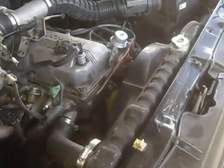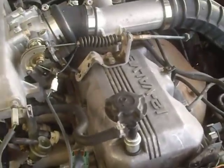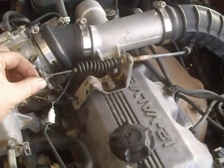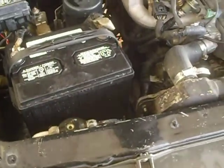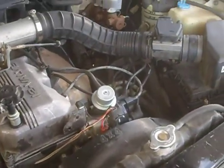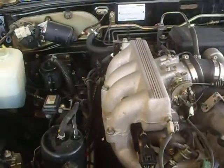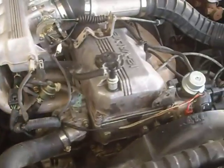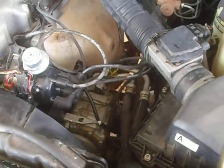It's running and it doesn't appear to be leaking. The next step is to go ahead and run it through its cycle, let it cool off, and then re-torque the head. Then I'll time it and throw some plug wires in it.